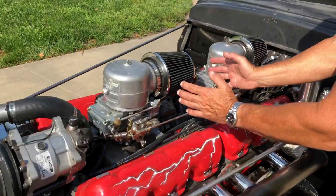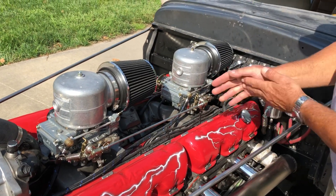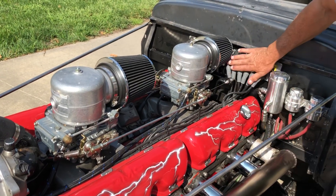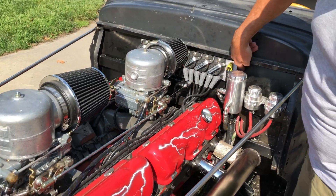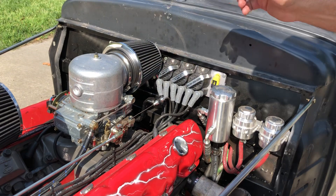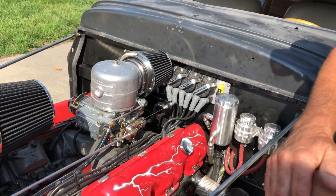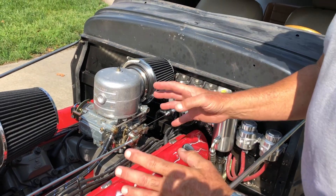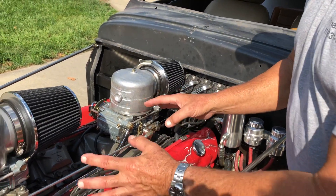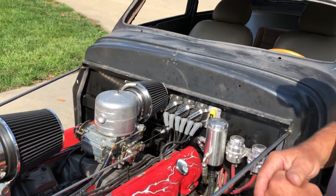The coils were taking up a lot of room in the center of the engine — this is the Thunder V12 setup. So what I did was move the coils back to the inner firewall. I bought a 100-foot roll of spark plug wire and ran some long leads. Now we have uncluttered the engine up in the center and got rid of the giant throttle linkage and all the rest of the stuff that was on there.